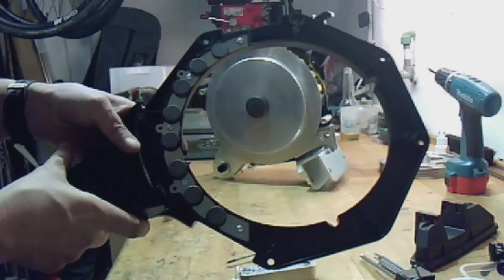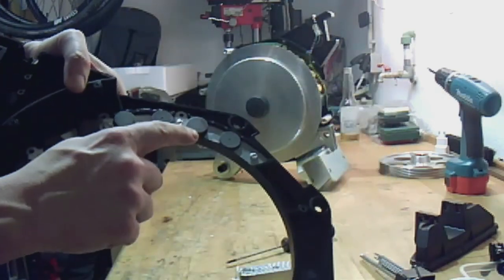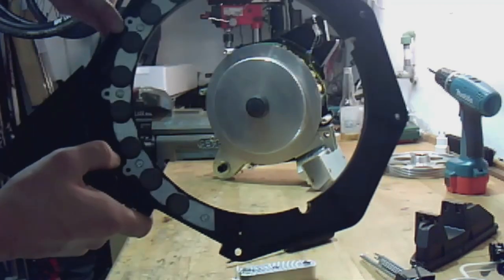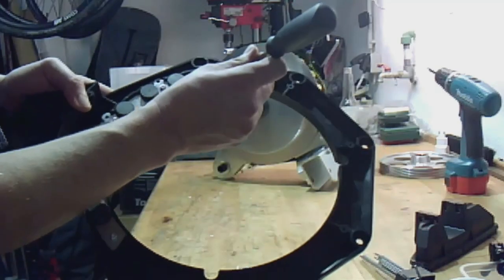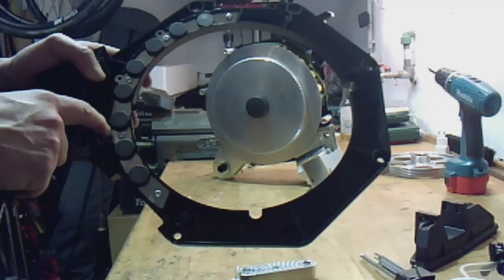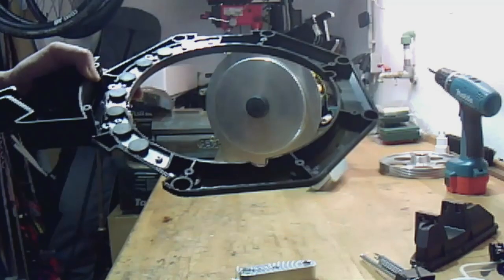So, now you can also check if every magnet is okay. They are positioned with dot, non-dot, dot, non-dot, and so on. So if you one time put a long screw in a wrong hole, sometimes these magnets get damaged, they fall down. Then you have to remove the screws with the T20. Then you can take out the metal plate with the magnets on, and if there's a dent, just use a hammer and knock it out and stick the magnets back on, but in the right dot, non-dot order, and you can repair this also.